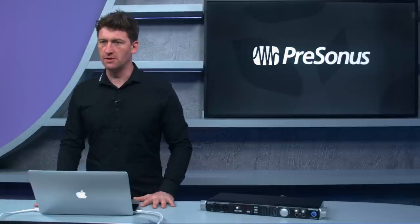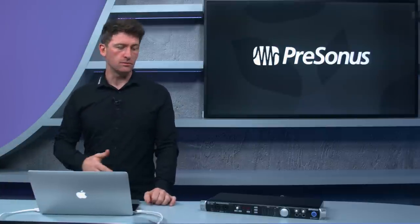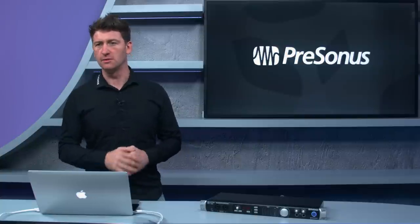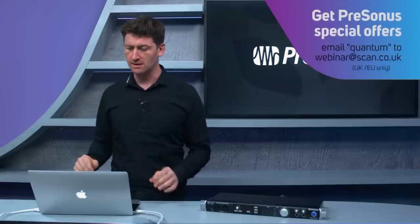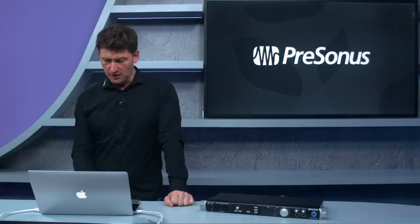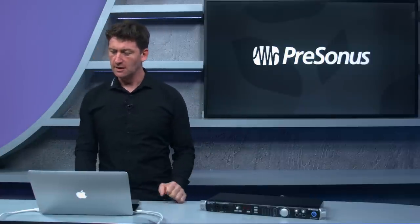If you're using Studio One you get some extra benefits, though Thunderbolt works perfectly with third-party DAWs too. The low latency means it plugs straight into your DAW, working seamlessly with plugins on input channels sounding tight and in time. In Studio One, the right side of the mixer panel gives extra controls for the unit itself — built-in talkback with level, headphone assign, and dim, mono, and mute buttons — making the whole system very closely integrated and fast.